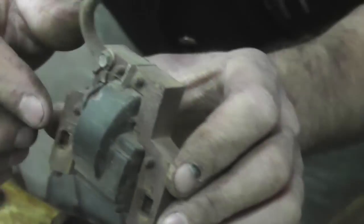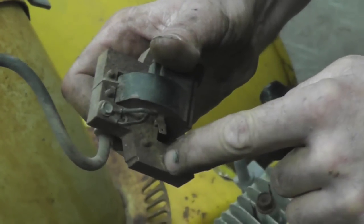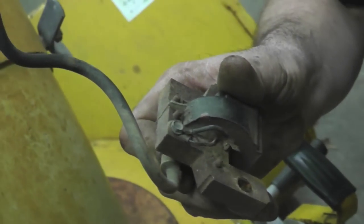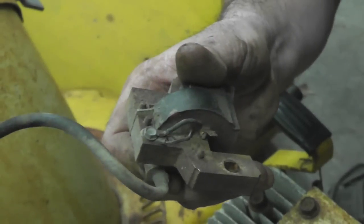That's the only wire. If you take a little piece of wire and go from here to ground, it's going to kill the motor. You want to test this coil — you just pull that kill wire off, and that's how you test it. If it don't spark, it's bad. If it sparks, then your kill wire is grounded somewhere.